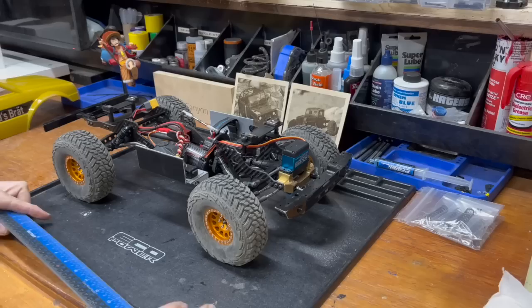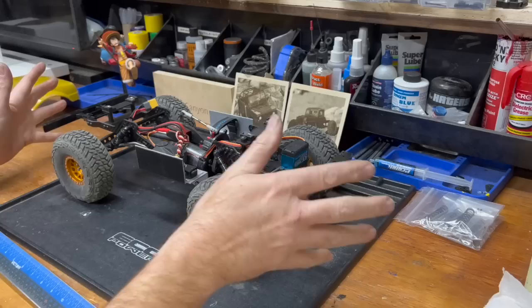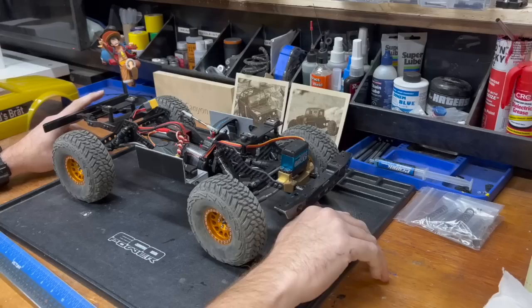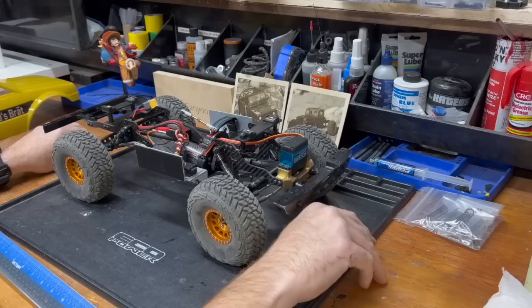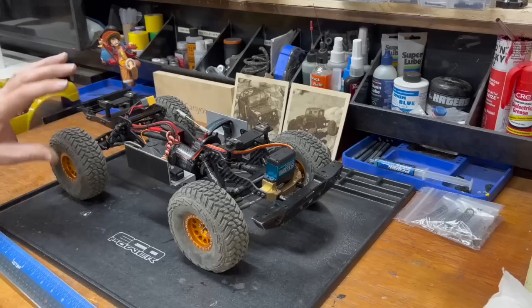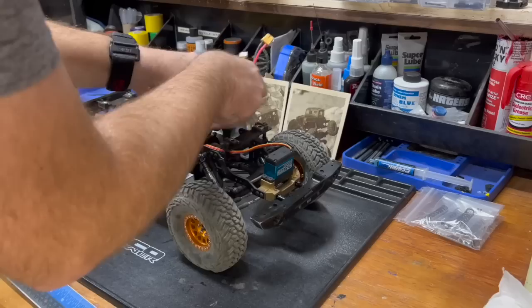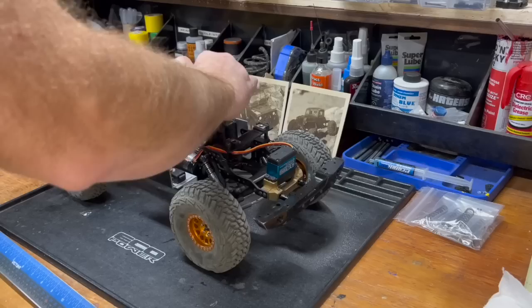The top of the front bumper is three and a half inches off the ground, and the top of the rear bumper is four and a quarter inches off the ground. The spring rate in the front — we need a spring kit on this guy because he needs to sit right about there. Those springs can't hold this front end up. The flex is now pretty much where I want it to be — he had way too much on 90s. And we are going to put a little bit of weight on right now — a battery — in order to head out into the wind.